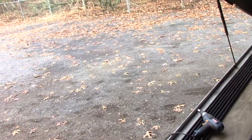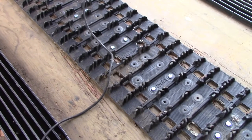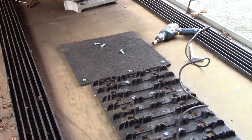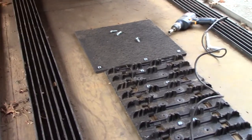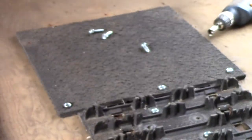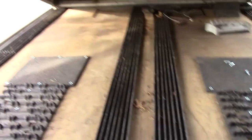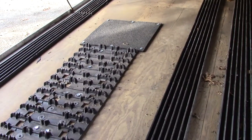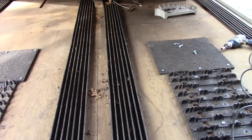As you can see it's taking a beating, but it is a little trailer so it's actually not too bad of shape for the abuse it gets. This project cost me literally nothing — this track is repurposed, and even those lag bolts I got from a friend, a couple hundred of them. I'm not even pre-drilling, just going right into the wood. They'll rust over time but they're thick so it'll take a while. For an eight-foot trailer, just the track alone would work, but for a 12-foot trailer it drives in kind of deep, so I used that stud mat to take up where the front part of the track will be sitting.